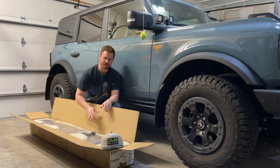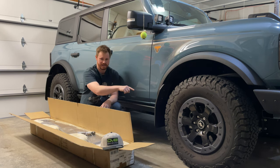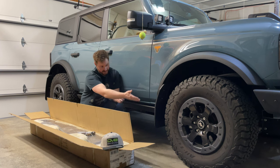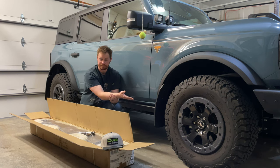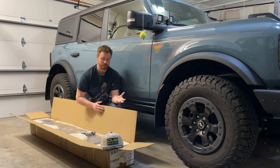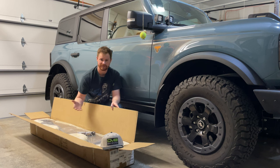Giving a review on my last DV8 A-arm install, I found that at full turn or full lock of the steering wheel, the inside section — if you have inner wheel weights — they actually contact the A-arm skid. At least on this tire it did; the other one had a thinner wheel weight so it doesn't rub. Coincidentally my wheel weight fell off this wheel, so I don't notice it too much on the highway. For providing that review to DV8 on their website, they decided to give me a little bit of a discount code.